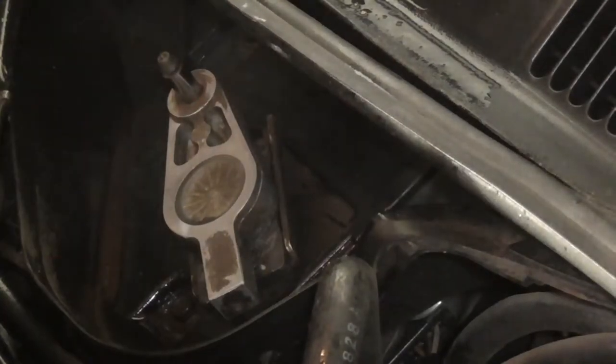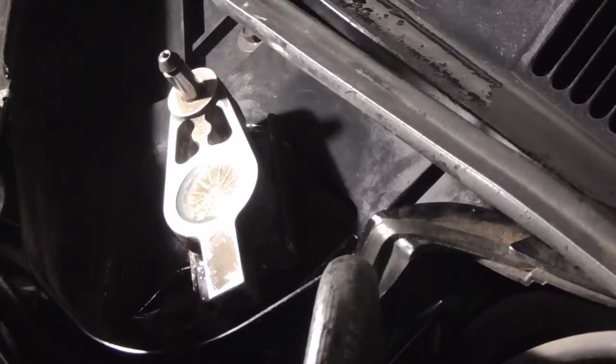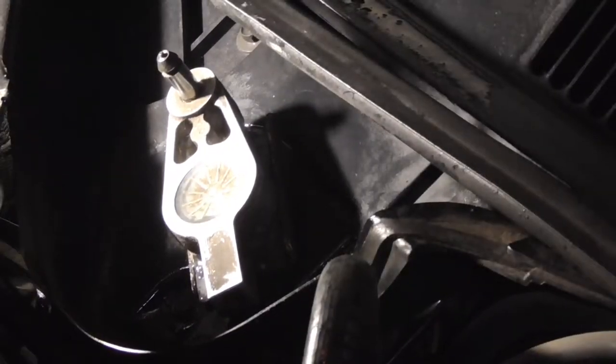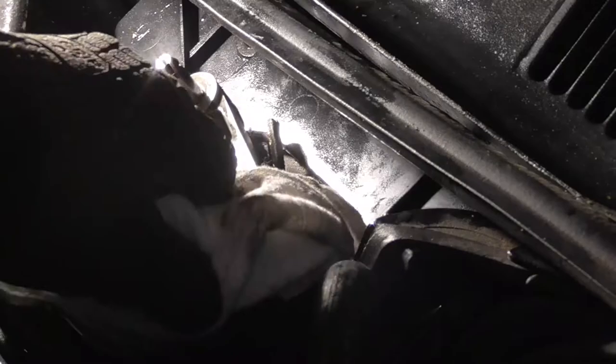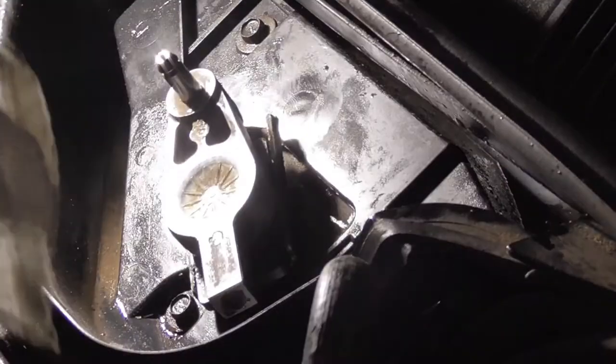Here is the fix. First, I'm going to continue to clean the assembly and then blow it out once again. Be careful when you clean — you want to be sure to clean the upper, lower, bottom, and also the surrounding area. There is no damage mechanically here. It was just corrosion, crud, or debris that is stopping the rotor armature from catching on the correct spot on the plate below it.